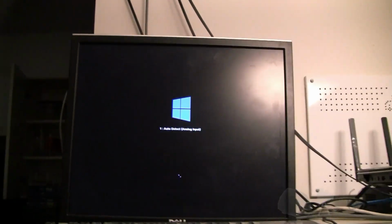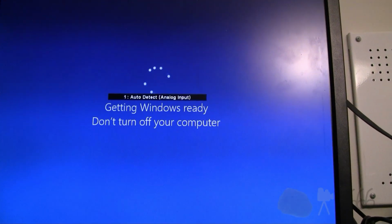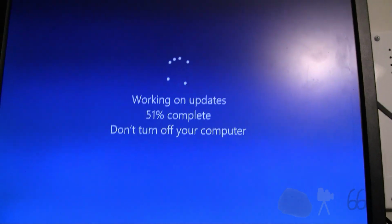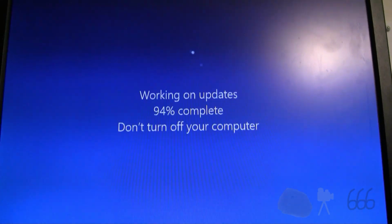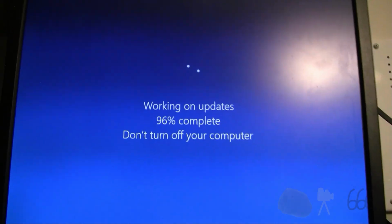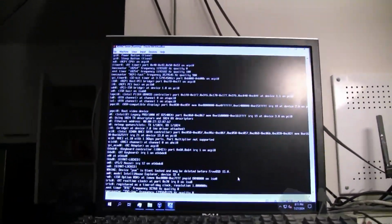Well, I might not have, but it doesn't really matter because that optical drive, the SATA connector is missing. It's just the little metal tabs on it. Yeah, looks like we are running in 640 by 480, but it is there. I'll have to install all the drivers now. Okay, just getting the VM started on that. It looks like everything on this front is now good to go.